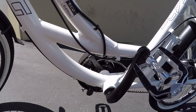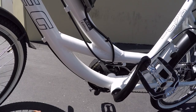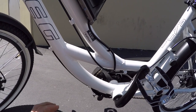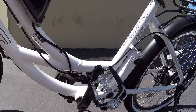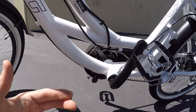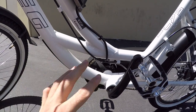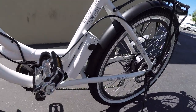This is a 12-magnet cadence sensor, so it's very responsive. As soon as you start pedaling, it kicks in, but you don't really have to push very hard. That's the difference between a cadence sensor and a torque sensor — torque sensor is smoother and nice for off-roading where you want to feel like the bike is responding naturally in both quickness and power. With this cadence sensor it's just on or off, but you only have to move your feet. I kind of like that.